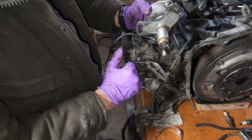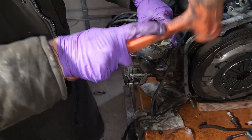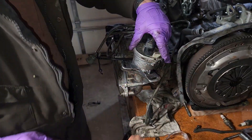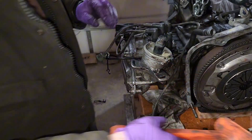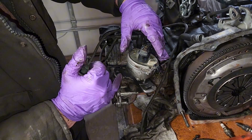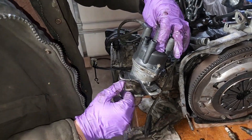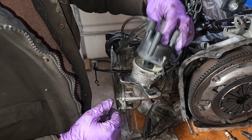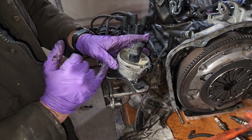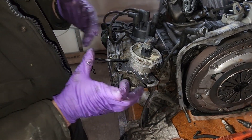We're going to have to get this gear lined up with the gear on the camshaft. These distributors can get kind of tight, so you've got to hit them with a hammer gently. With this gear here, it's fixed to the camshaft. This movement here is just to advance or retard your timing on the distributor itself. But all of the gears need to match with this right at the number one cylinder. So we're going to take our distributor cap and confirm — I would say that's a win. Confirm you're locked in and this isn't going to move without engine rotation. Now we can bolt these down and get our timing adjusted from there. This should fire off enough for us to at least get the engine idling and then make our final adjustments.